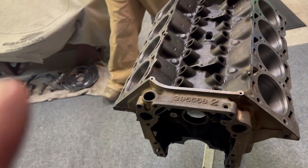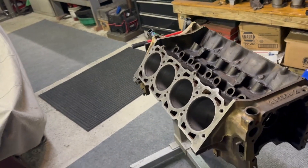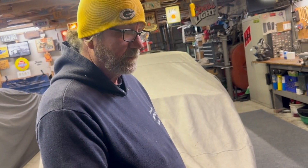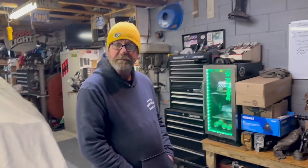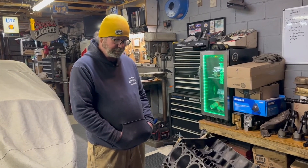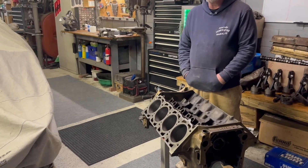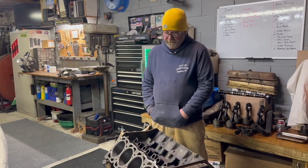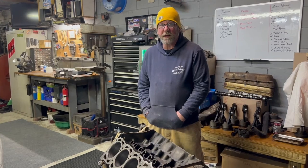We're getting ready to do a final clean on this. The crank — you saw it get polished last week. Once this thing is cleaned, we'll show you our new cam bearing tool. We did knock out all the old cam bearings and I have them in stock — how they came out, they're nasty. I think when Joe comes up, John, Joe, and I will show the most efficient way: measure as we go. We'll measure our main bore clearances, our crankshaft mains, which I have done and recorded some of that. Either way, it's going back together. No one's going to be able to tell us those cylinders are overboard — no, we know they're overboard, and we'll tell you by how much.